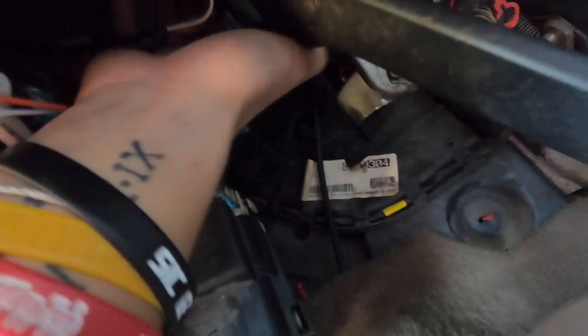This is how you're going to connect the Hydroboost to the brake pedal. First thing you want to do is slide the shaft from the Hydroboost into right there where your brake pedal is. So you're gonna put it in like that first, and then you're gonna slide this up in there like that, and then slide it in — just like so.